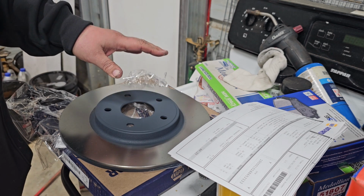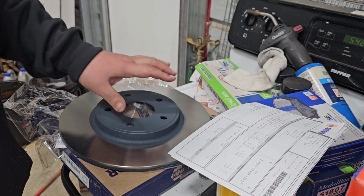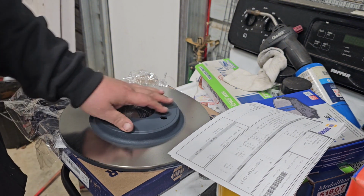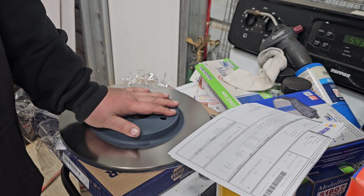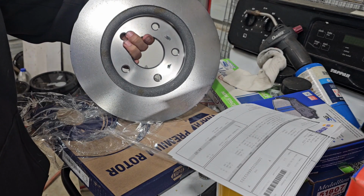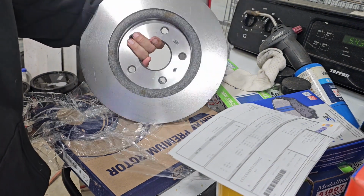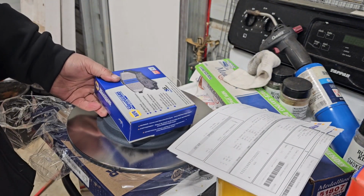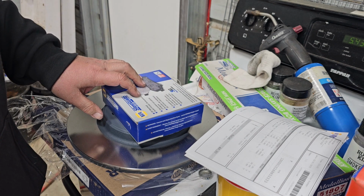Mine has a single. And I couldn't remember the reason mine having heavy duty brakes on it. But I called a buddy of mine that works in the parts department at the Dodge dealership, and he looked mine up by VIN. Mine does take the heavy duty, but it does not have dual pistons on the rear. But it has the bigger rotors on it. So with that being said, I had to take the other ones back because they were about 1/4 of an inch to 1/2 inch too small. These ones here look correct. They're nice and big. Also the pads were too small, and I had to get another set of pads as well. And he had to search for these pads, and he finally found them.